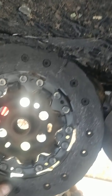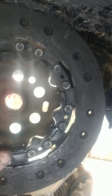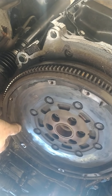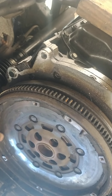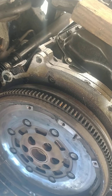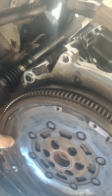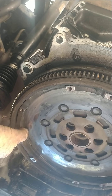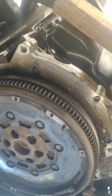Look at that — the flywheel side has barely a slight amount of meat left. The dual mass flywheel seems to be within spec in terms of how far it can go in either direction. It's just a case of a disintegrated clutch plate, no big deal — let's put on a new one. I'm tempted to replace the oil seal, but I'm also tempted to just put it back together with the new clutch plate and cover. Thanks for watching — clutch port, part one.